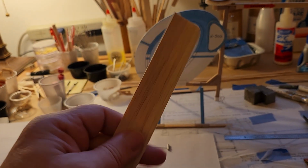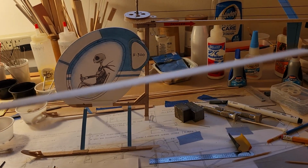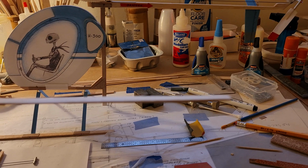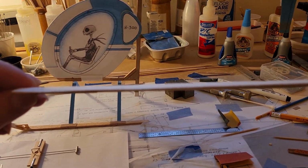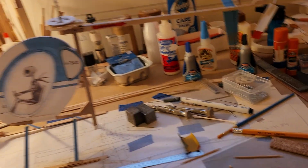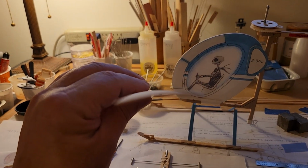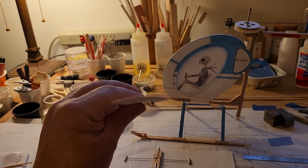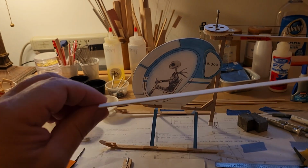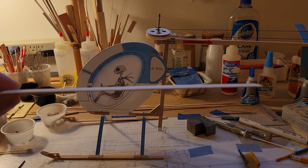Now if you look at the rotor blade, I'm going to lay it out, and you're going to see from the root forward, it is beautifully straight. I have no bumps, no curves, no nothing. That's blade number 1. We're going to go to blade number 2. Again, you want to get the curve on a 3-inch form exactly the same, just like that. This is blade number 2. So they're very nice, very smooth. You look at the thickness, it's a uniform thickness across, nice sanding.